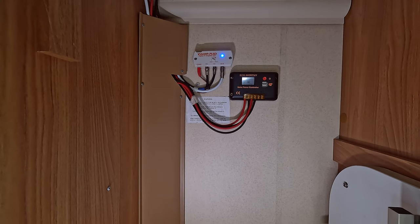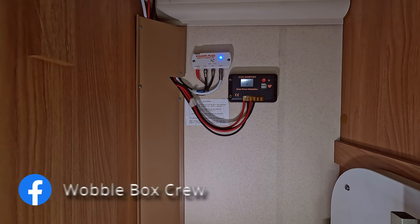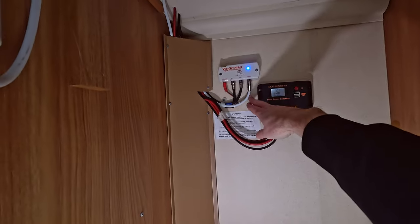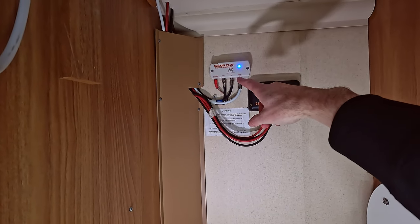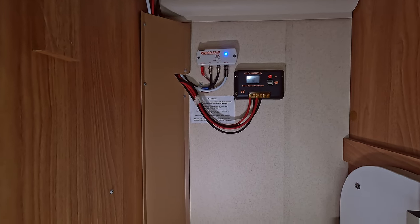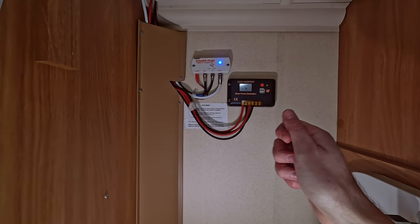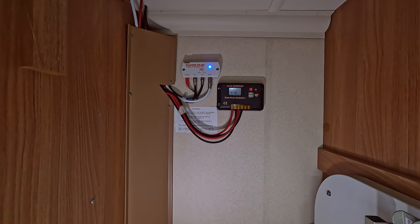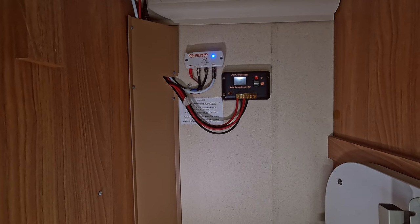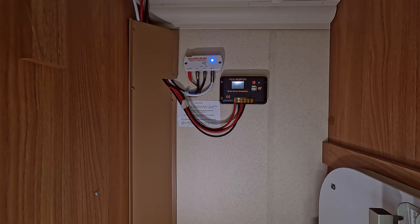This is the TV amplifier. It runs off 12 volt, it has a switch on the top, and when it's working you normally have the blue light come on. This is quite a standard model that you see in caravans — yours might be slightly different but the principle is the same. You've got the TV aerial coming in off the roof, feeding the sockets around your caravan. You need to make sure the connections are done up tight — they are twist connections, not your standard push-in ones you have at home, because when you're traveling they can rattle loose. It is crucial that you remember to turn this off before traveling home, as it will be drawing power and can cause a flat battery.